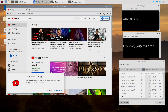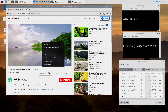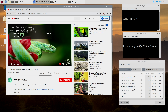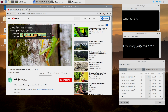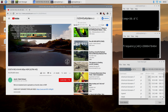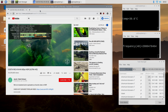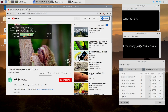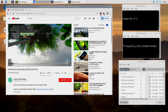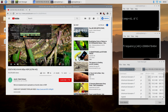Unfortunately, YouTube video playback just isn't going to be fixed by overclocking the GPU or the CPU. We're still going to have stutters even at 720p, and until the Raspberry Pi Foundation comes up with a fix for this, that's what we're going to get. At 720p we're still going to have lots of dropped frames. It actually seems to handle it a little better than at stock clocks, but overall using the Raspberry Pi 4 with Raspbian for YouTube video playback just isn't going to be a great experience. I've also blocked 60fps here with H.264ify — if I turn that off we're only at five dropped frames, but if I reload at 720p 60fps we get a ton of dropped frames. If you want to get by, just turn on Block 60fps videos in H.264ify and you'll have a lot less dropped frames, but you'll only be running at 30fps.